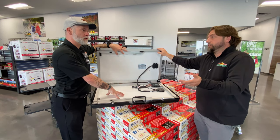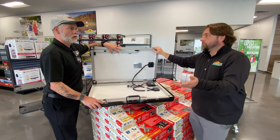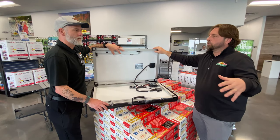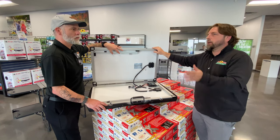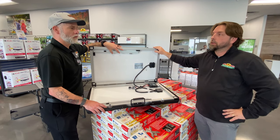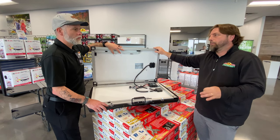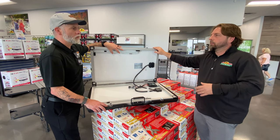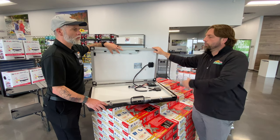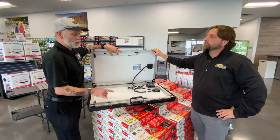Definitely can't do the big appliances, but you can upgrade your kit. Some newer RVs have residential fridges that are 110-volt AC, so you'd need more panels — probably step up to 170-watt panels, a couple of those, and you could run those residential refrigerators. They're actually surprisingly low on average draw, but the problem is they run for so long that they'll drain the power down quickly, so you need more panels — but it can be done.